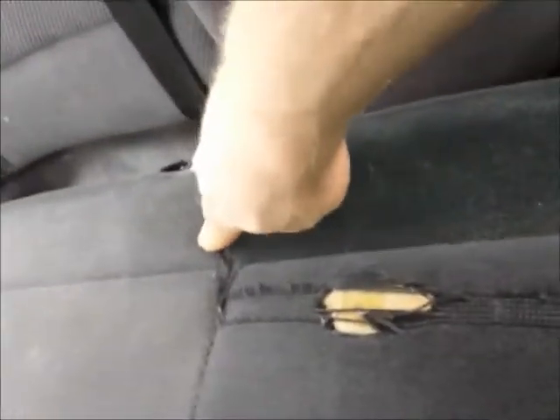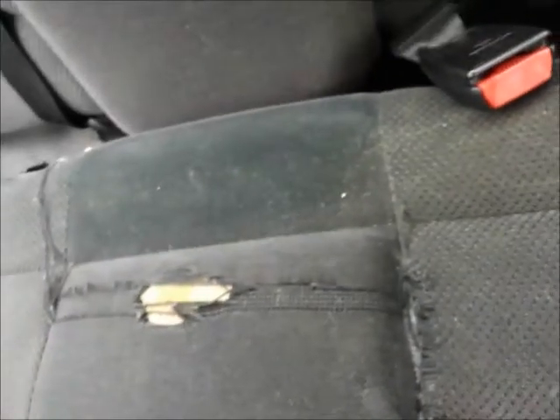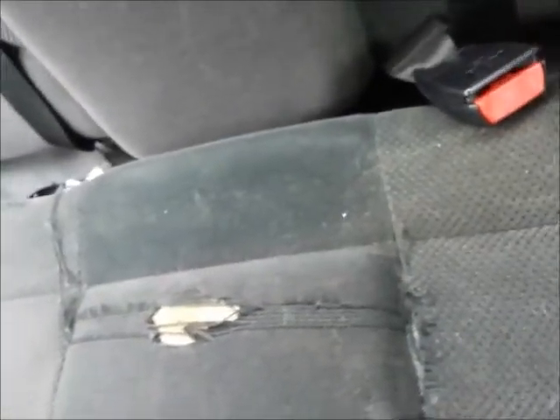After that, you just slide it forwards. With the E39s, the seat buckles go through cutouts here and here, so once you lift up the front of the seat, lift it just over those carefully and slide it out. There's no connectors at the back, so don't worry about those. Now, I've just done the rear parcel tray paint on my friend's 540 E39, but these seats I haven't taken out for a while.